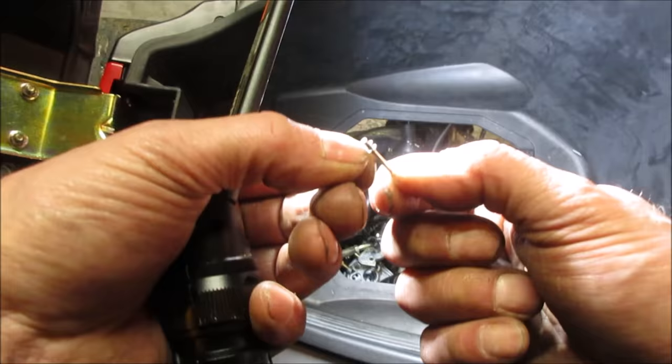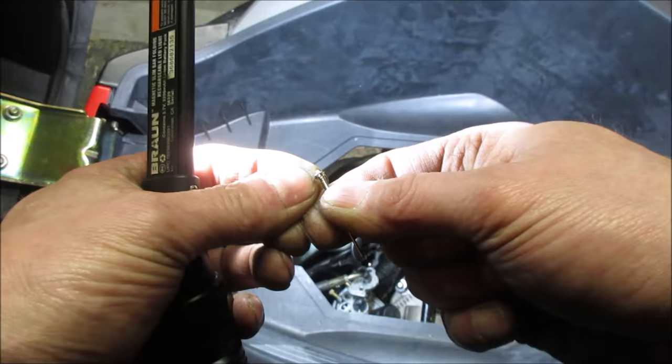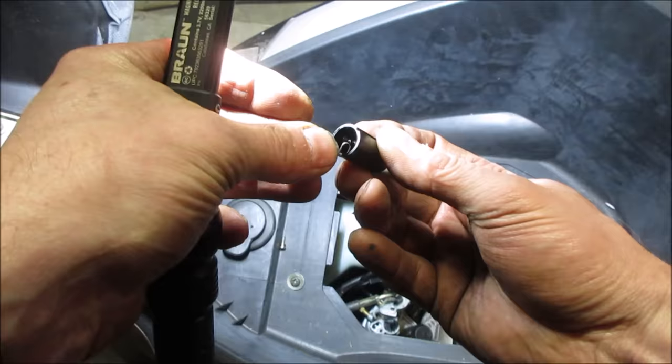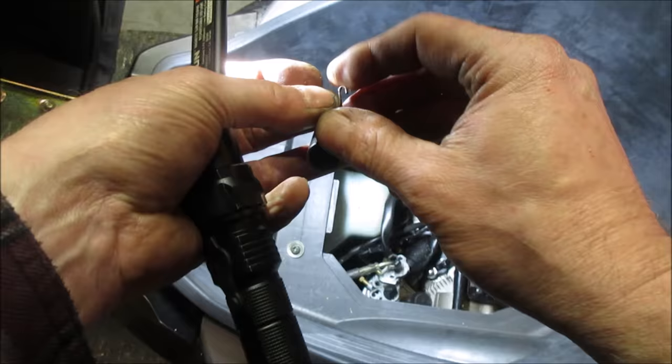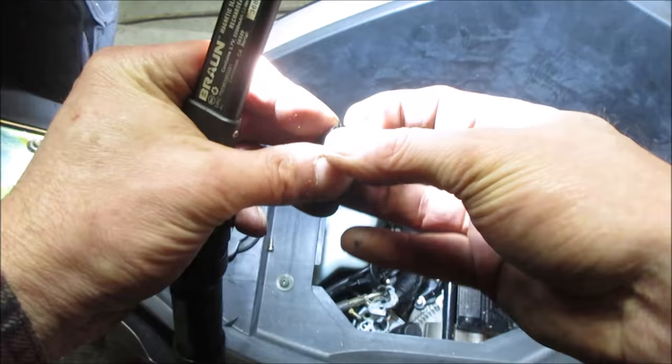So you move the C-clip, go all the way, and see if we get any major adjustment on it too. That's gonna allow the pin to stay lower, allowing less fuel to hit at higher RPMs. Make sense? If not, I think the parts for these are fairly cheap as far as electronics are concerned. Maybe we'll order another one of those CDIs. Probably like $20 or something. At least it runs.